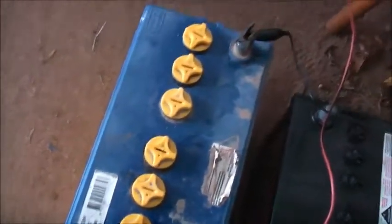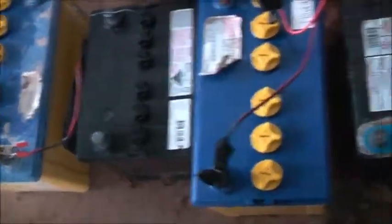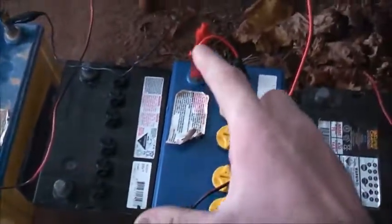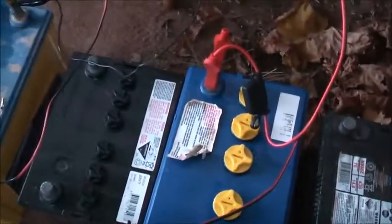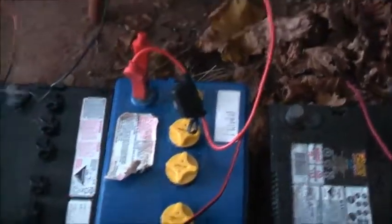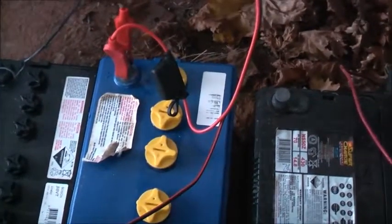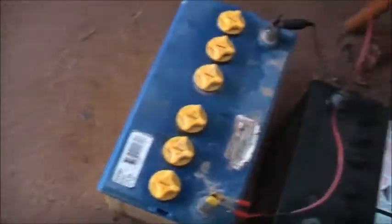Look for 'Alum' — probably listed as high-claw or similar — in the supermarket. That's probably where I'm going to get the alum from, because you can get it in a two-kilogram bucket. It's the right alum we need: aluminium sulphate for these batteries. I think one video I watched used 100 grams of alum per one litre of water. Let's see how that ratio works.